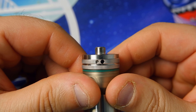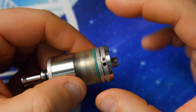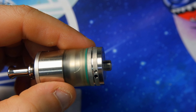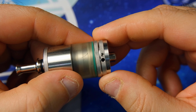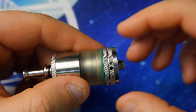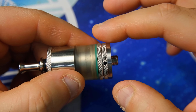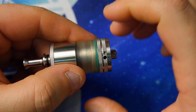There are two fixed air holes: the larger one should be about 2.2mm, and the smaller one about 1.5mm. The 1.5mm hole is currently closed with a grub screw, but it can be opened using the hexagonal key. For now I'll leave it closed. Moving upward, we can see the classic Typhoon machining.